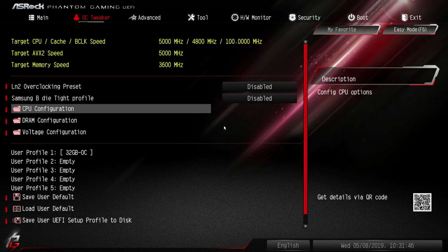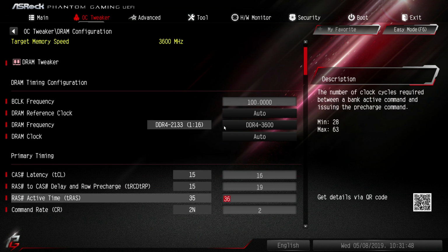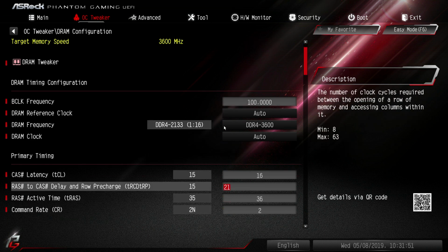Yeah, okay, that errored. I wonder if that's the TRCD doing that. I think it's probably the TRCD. That one tends to have, there's only one memory IC where TRCD can match TCL across the entire frequency range, and that's B-die. Everywhere else, it normally needs to be significantly higher than TCL. So, yeah, I think it's TRCD. Unless I am proven wrong. Yeah, okay. I am wrong.